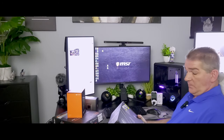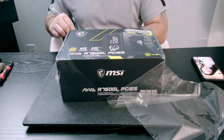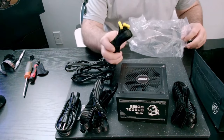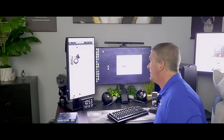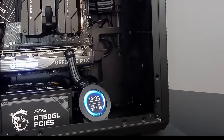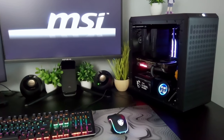For the power supply, we went with the MSI MAG A750GL, PCIe 5 ready. It comes with ATX 3.0 compatibility, so if you go with a 40 series card that has that connectivity already built in, you don't have to use the included adapter. This is gold rated, so efficiency is going to be really good, which is important in today's build. We also added a 2.1 inch round LCD screen that I picked up on Prime Day for about $25 — currently it's back up to $71, but for $25 you can't go wrong. It gives you temperatures and has a nice little aesthetic. That was the final build list. I'm not going to go through a detailed build guide, but I will show the final product and then let's hop into some gameplay.